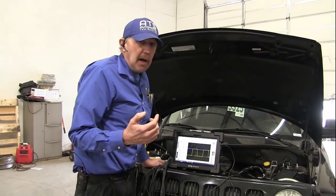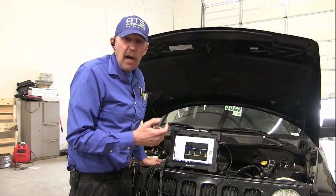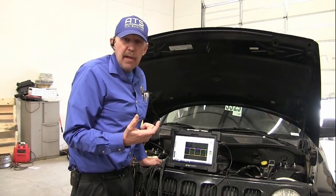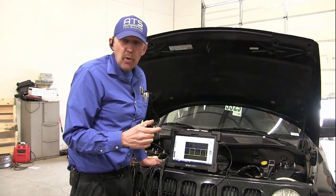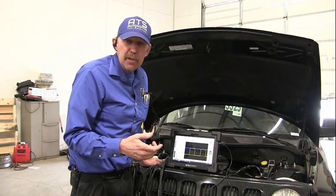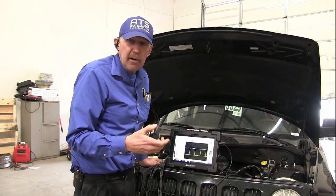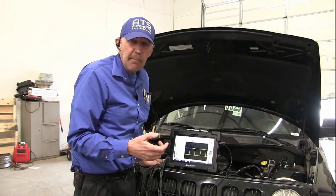Now the other thing is I'm bashing this aftermarket sensor, but I shouldn't do that, because this thing's been getting hit by this high voltage from a coil, and it gets punch drunk. After it gets hit and hit and hit, it just stops working. That crank sensor has doped silicon in it. They're ICs, integrated circuits. The actual Hall effect sensor is doped. The operational amplifier, that's another doped silicon. The Schmitt trigger is doped silicon, and the transistor is doped silicon. And we all know that integrated circuits, silicon that has impurities added to make it work, they do not do good with negative spikes. It will take them out, it ruins them.